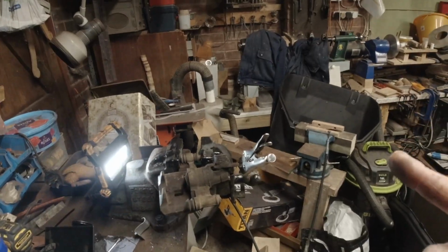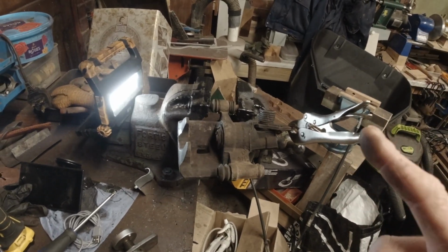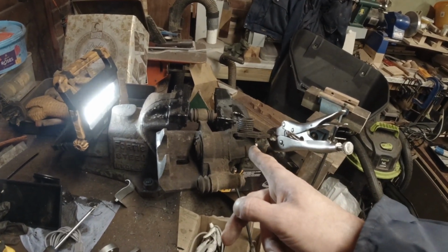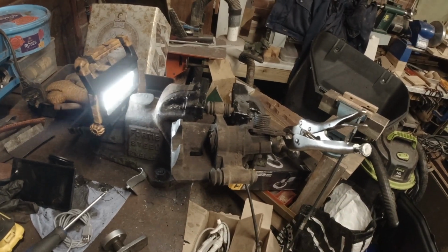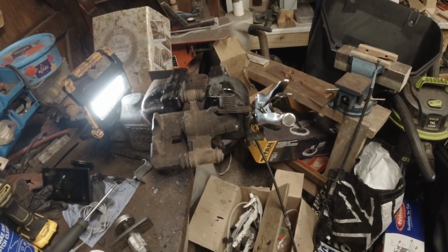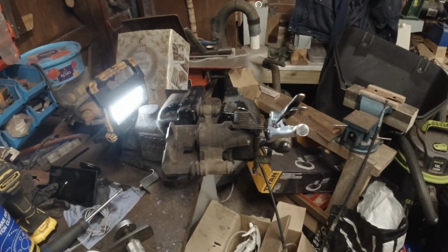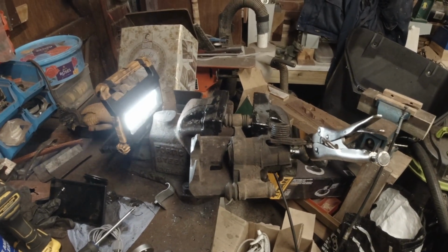So what you have to do on these MR2s when you're setting up these calipers for the first time, after winding that piston back, that hasn't latched onto the ratchet mechanism yet, because you've got to force the piston out with the foot brake. So I'll show you the trick I've discovered today, and I'll show you my results on the compensator in the car. So let me take you in the car now and I'll show you.